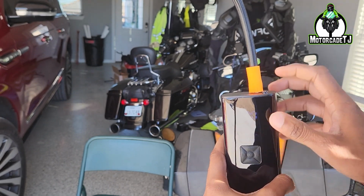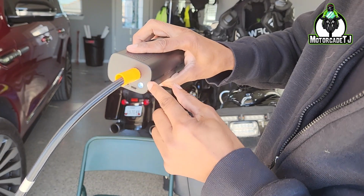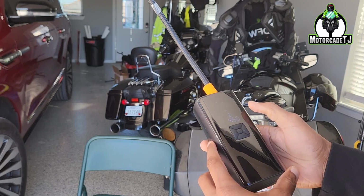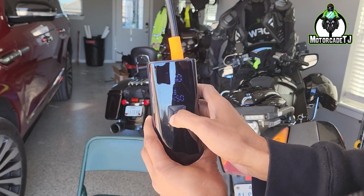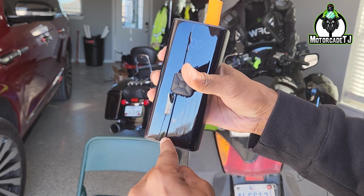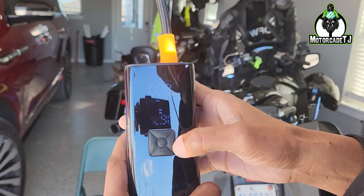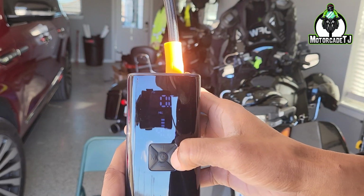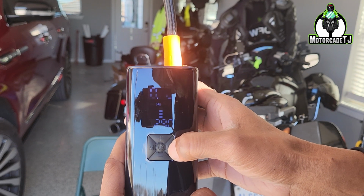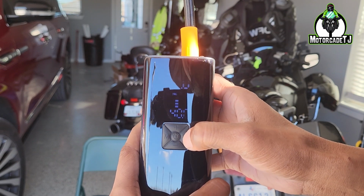activates off and on. I told you about the flashlight at the top. If you hold that U button, it activates the flashlight. Hold U again long, press it, and it will go off. One other cool feature is if you long press this M, it will activate some distress lights. You can kind of see at the bottom here, it's flashing from blue to red, and then long press the U again to go off. If you push this U button, it's going to cycle between PSI, bar, kPa, and kilograms per cm squared. Not sure what that is, but it cycles through the different units of measure.